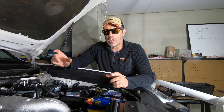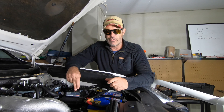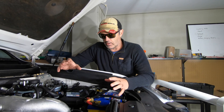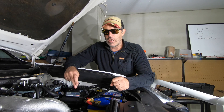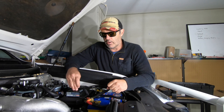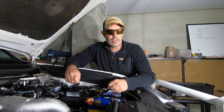I found a really good little gauge — not cheap, but does exactly what I want — and I'll show you that. I'm also going to hook my panels up to here versus the controller that's on the panel. So the panels have a PWM controller; this has an MPPT controller. This controller is supposed to be more efficient than PWM, and there's some discussion around the pros and cons of each type. I'll explain in layman's terms why the RedArc should be better. So let's go and get this gauge installed.